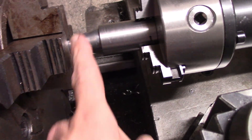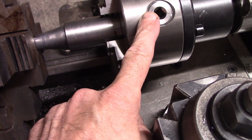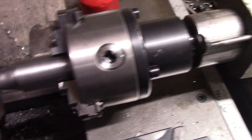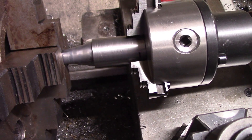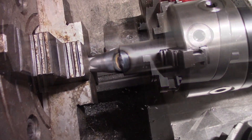After cutting the shaft, I machined a tight-fitting sleeve to go over it. To keep everything running true, I put the end of the steering shaft in a four-jaw chuck and dialed it in to minimize the runout. I then put the tube in a rotating tailstock chuck and proceeded to tack everything together.